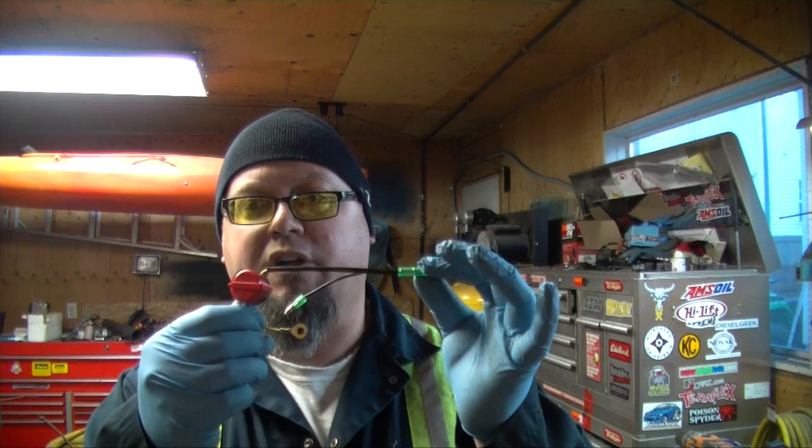In this video we're working on the Honda GX120. It has a low oil level sensor and someone has bypassed it. I got a new switch here so we're going to have a look at the wiring diagrams. If you ever have an issue where your low oil sensor is faulty, I'm going to show you how to bypass it to keep your engine running. We're also going to hook up this new one and do some testing — maybe that sensor is faulty, maybe that's why it was bypassed. That's something we're about to find out.